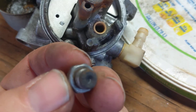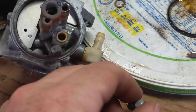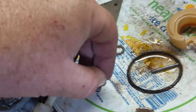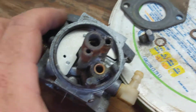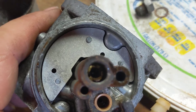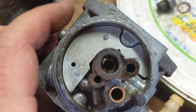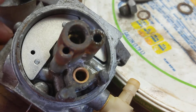That bolt end is also all rusted up, and I'm afraid that when I start digging in there to clean the hole out I'm going to make it bigger than it's supposed to be because of the rust. I just put the air hose and blew through both of these holes — my guess is they're supposed to be open. I tried to get the jet out with a screwdriver but it just starts to turn, so I was afraid I'd strip it. These two other holes — nothing goes through them blowing air or brake cleaner, so those are probably clogged as well.